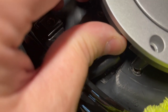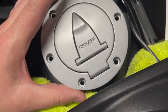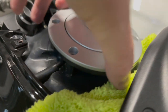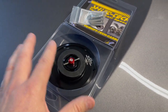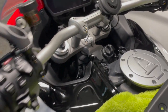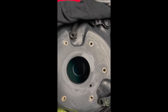There's a little breather hose connected on this side and also on that side. You need to gently lever those off with a pair of pliers, and then the whole housing should come off. The underside of the housing is going to screw onto the top part of your gas cap replacement. There's a rubber washer there and also a gasket beneath this to keep it fuel tight. With the gas cap removed, you can see the fuel down there.